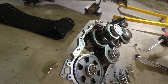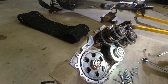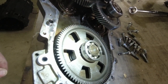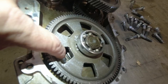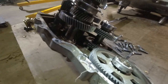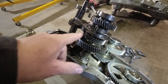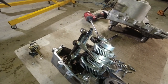This machine has about 8,400 miles on it, but the transmission has been trouble-free up until this point. You can see a whole bunch of grindies in there. Down in there, a bunch of balls are missing out of that ball bearing, and if we come up here and look, there's been a whole bunch of damage to the teeth on these gears.